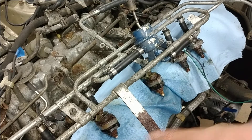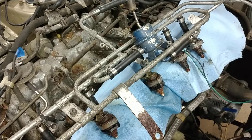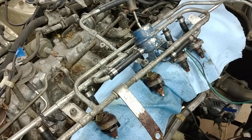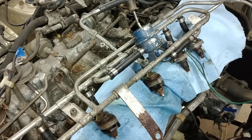Next I've got to disconnect the pump, take all those hoses loose, take those injectors off, and I'm going to build myself an injector cleaner rig — because I'm not going to replace these unless I absolutely have to. I'll pop the filters out of them and see if I can backflow these guys and get them to act better — just good enough to make this engine run halfway decent. That's the plan, talk to you guys later.